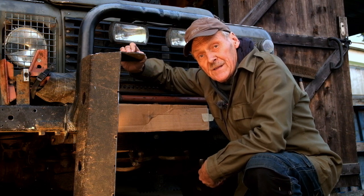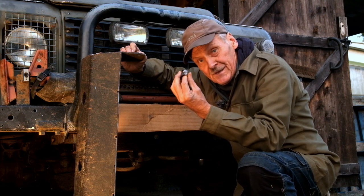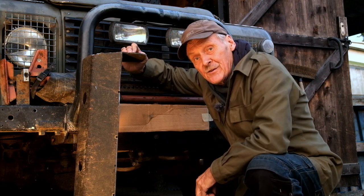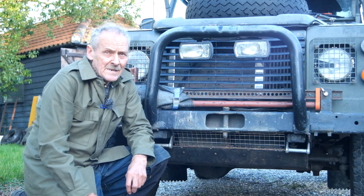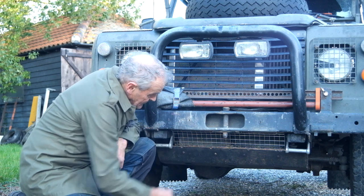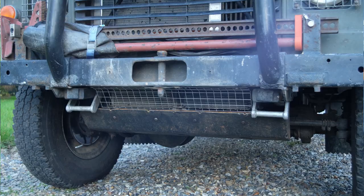I think they're very well protected, and indeed I've had no problems whatsoever in over 200,000 kilometres. But even if the worst comes to the worst and the coolers do get fractured, my contingency plan is to carry a couple of fittings like this, and I can offline the coolers by merely joining together the inlet and outlet oil pipes. I think this is far more effective than anything that Land Rover offers. When it's put back together again it looks like this — quite a busy little area. We have good airflow through to the oil coolers, the bash plate underneath, the protective mesh up here, and the two recovery points.